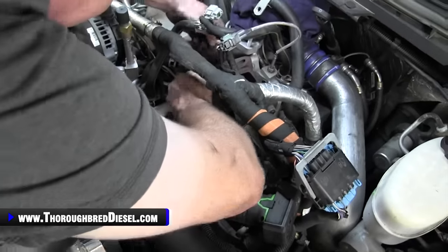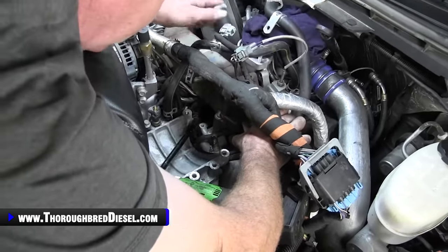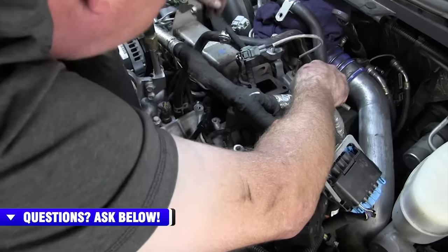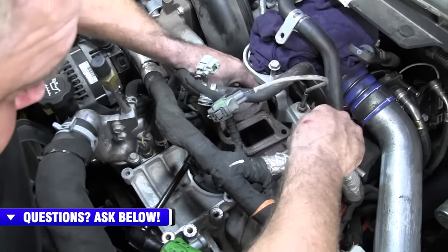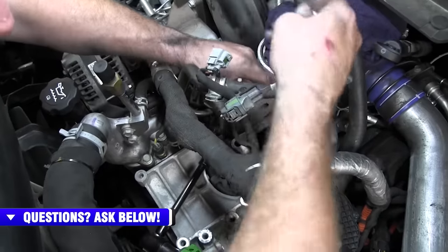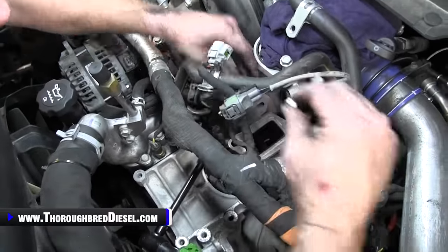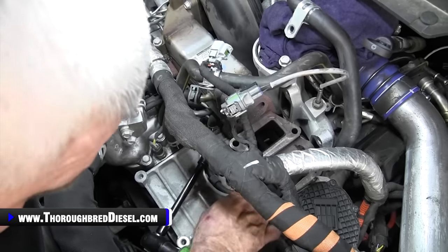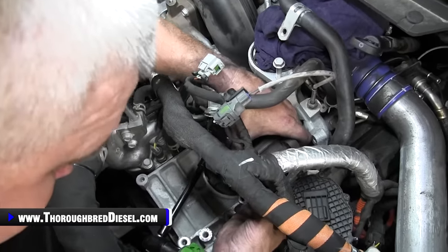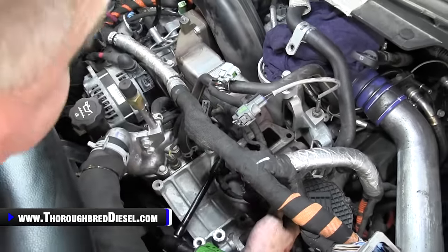All right. I'll pull these two bolts out, and then the valve will come off. So you've got a gasket on both upper portions. I've got that one. Tabs go up. And these two long bolts, and then the short bolts. And don't forget about the little devil on the bottom, because that one could be one of the ones that you drop in the runner because you're here.